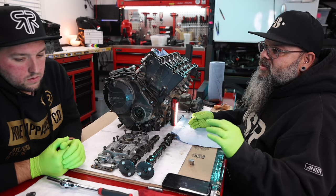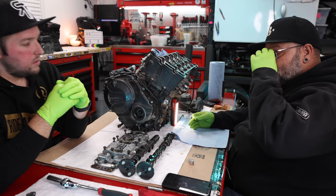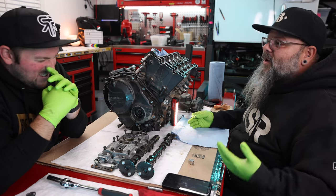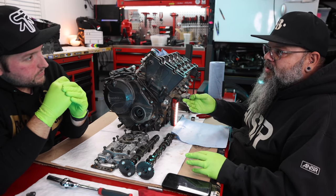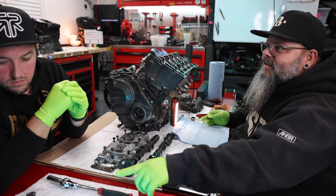And I don't think a one size shim is going to put me where I want to be. I think it's going to put me at the very small end of the spec, and I want to be at the bigger end or in the middle. Okay. So if we have to do it again, we have to do it again. It's me that has to redo the labor. So this is the way I do things. Right. It's really hard, like when you have something like this where your shims are all in metric, the 202 and a 195, and your micrometer is in standard.